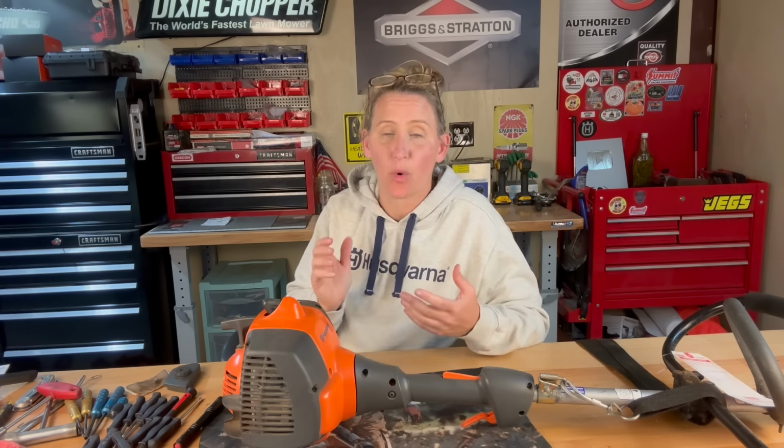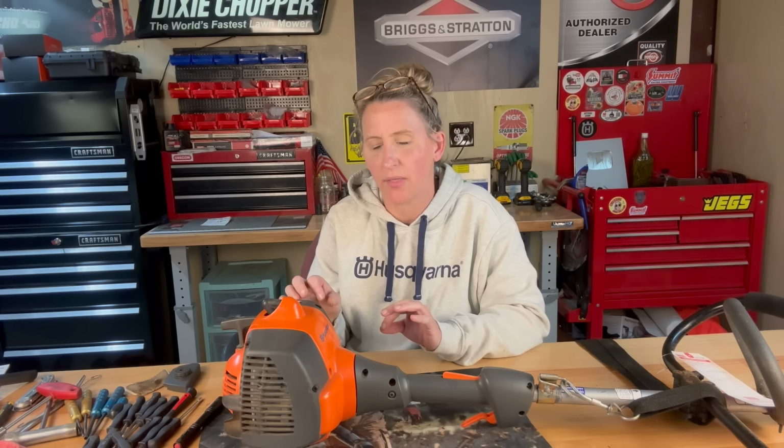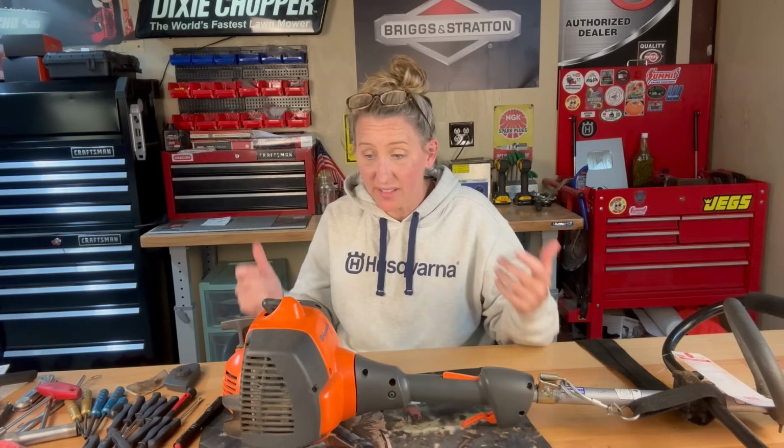It needs that little quarter turn. I went ahead and went another eighth out because it sounded still a little boggy on the high to me, but that's all it needs. Now, usually this is not a permanent fix. It'll probably last you the season, but when you come back to it next year, it's gonna do it again,